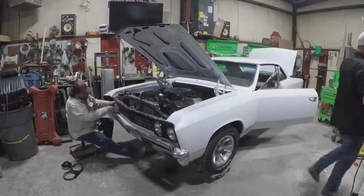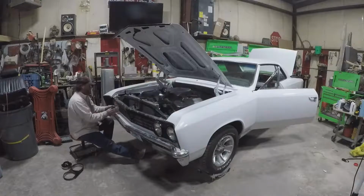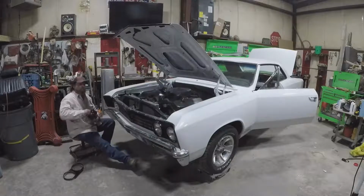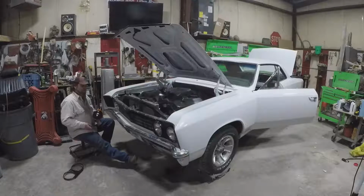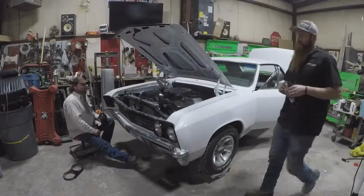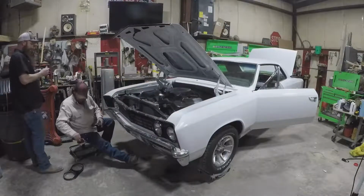Mike, I think I got the headlights. So the outside two headlights should have high and low filaments. The inside headlights should be the high only. The 3 pin should be on the outside, 2 pin on the inside. Stock operation. Yep, 2 on the inside, 3 on the outside. So that's still wrong, and the outside switch to high. This one won't go that way. So, do you care that much if it looks stock? Yes. Mike always does care that much. See, I'm all about taking the easy road.